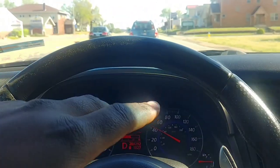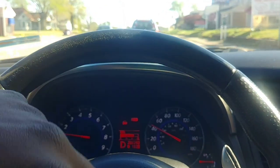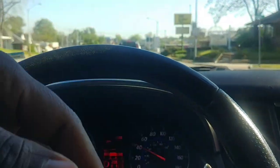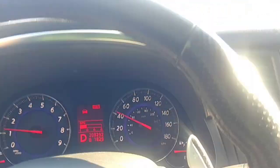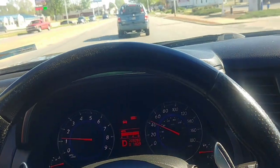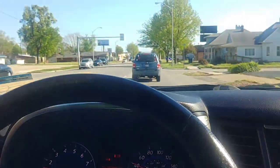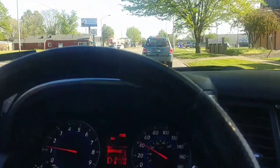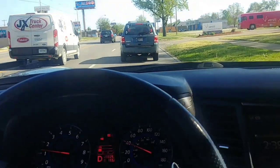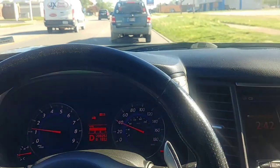DCA senses the speed of the car in front of you and your speed, and it controls your speed in two ways: one, it starts braking for you — applying about a quarter of the available braking power; and two, it pulls back on the accelerator pedal. Right now it's braking itself — my foot's not on the brake at all — because it's keeping a safe distance from the vehicle in front. You can override it by pushing the gas, but you can feel the resistance.